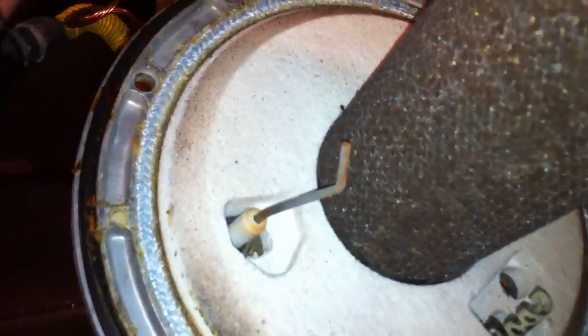There's your burner — that's what makes the fire happen on the inside. That's what senses the flame, and that's what sparks onto here, and that's what the gas comes through. Set that down carefully so you don't break it.